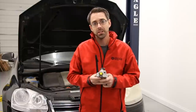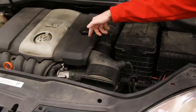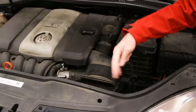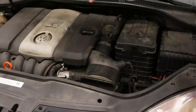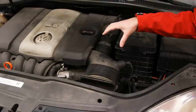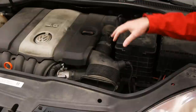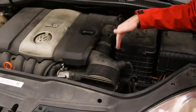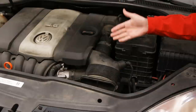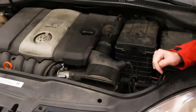Now let's talk a little bit more about specifics. If we take a look at our engine bay of our 2.5 engine, the vacuum pump is located right below here. This is the engine cover, the air filter is in here. You can see this duct — the air comes through here, this is the air box, it runs through there and comes back in here. Here's your mass airflow sensor. Right below here is actually where the vacuum pump is located. Because it is located right above the transmission, it will oftentimes leak down in between the bell housing of the transmission and the engine. The engine's on this side, transmission's on this side, and it'll leak straight down. Oftentimes you will diagnose this as a rear main seal leak, thinking that you need to replace your rear main seal, when it's just the vacuum pump leaking oil down from below there. So let's go beneath the car and check that out.